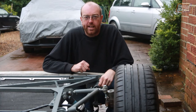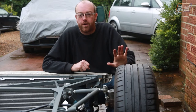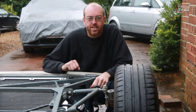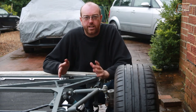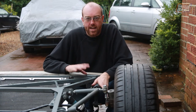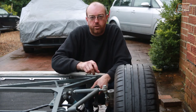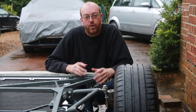With our slightly hacky stub mounts back in, you can see the wheel is at a much healthier angle. We've actually taken out almost all of the five degrees of camber, so we have a nice vertical wheel. However, it is a bit of a failure — our kingpin angle is now about 26 degrees, which is huge. Normally you'd expect something between 6 and 14 degrees in a road car, so 26 is pretty massive and we need to take that down a lot. To do that, we're going to have to extend our arms out, which will affect our anti-roll bar linkage. Putting some custom ones in with heim joints should solve most of that problem. So in short, this was a failure, but at least we have a successful plan.